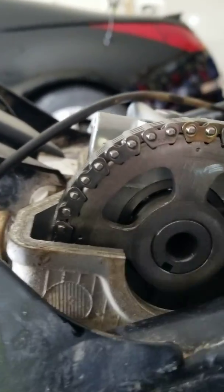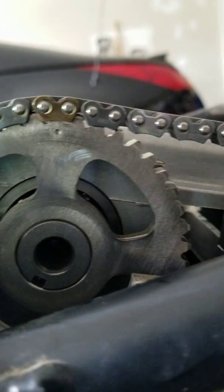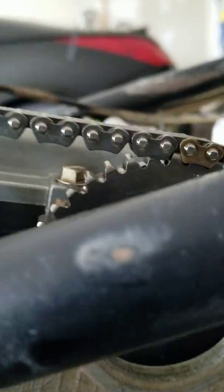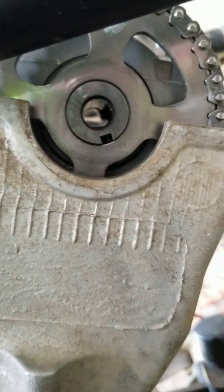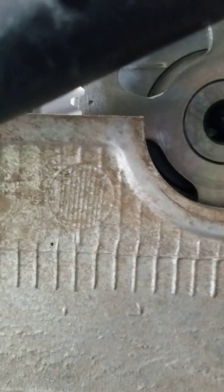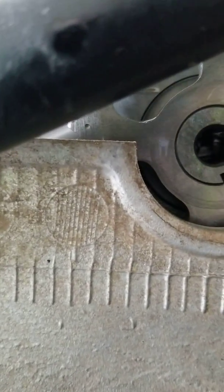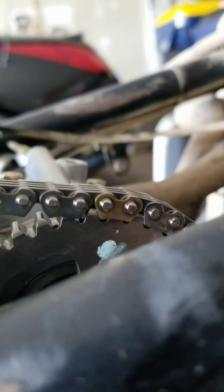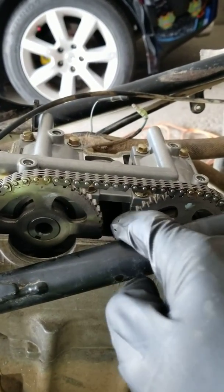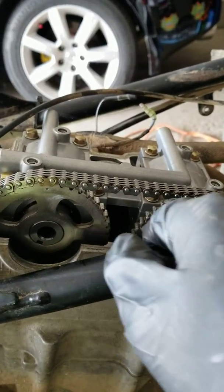Here's your dot to the left that's parallel with the case — that's 12 o'clock. But the exhaust cam over here is a little bit different. If we're on this side of the quad it's gonna be a little bit more clockwise. See the dot right there? It's actually raised a little bit above the case, and that dot is a little bit that way as well. So the two dots that are horizontal and parallel with the case are going to be facing this way — that side and that side.